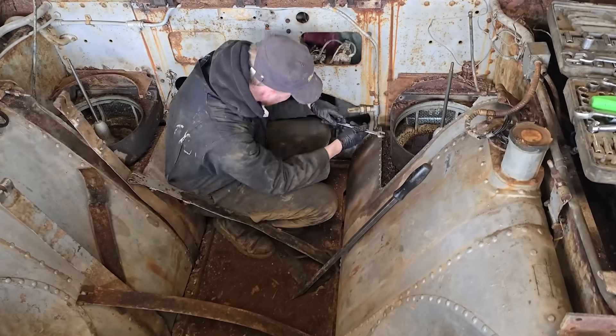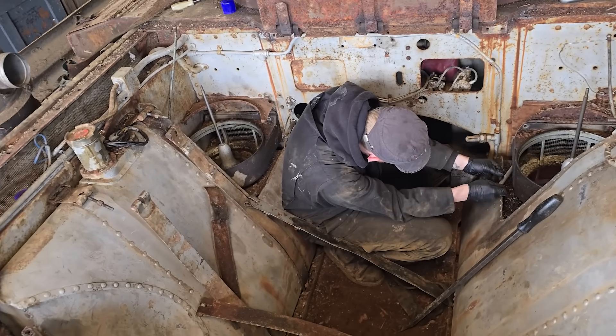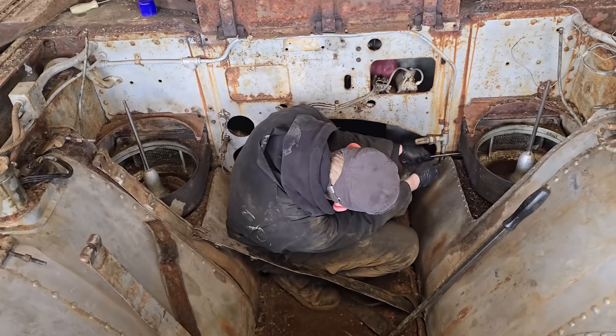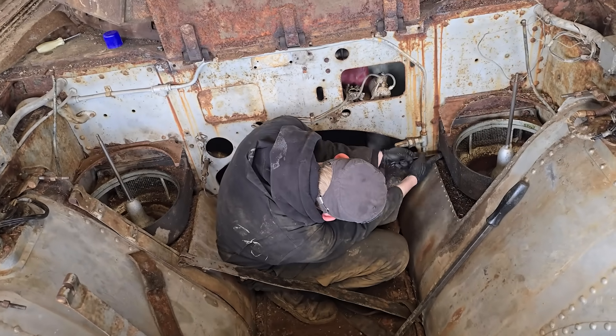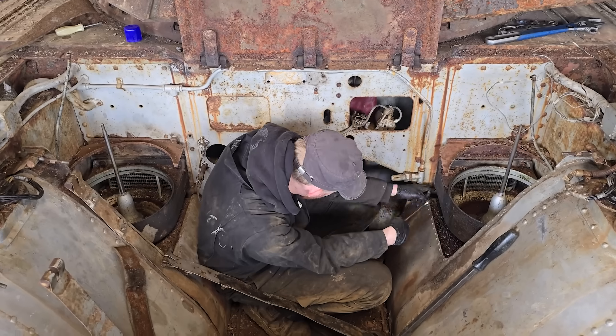There are other parts to think about within the engine bay — the air filters and pipes, fuel and water lines that run around the sides, all must be carefully capped off, checked for integrity and changed accordingly whilst the engine is out.